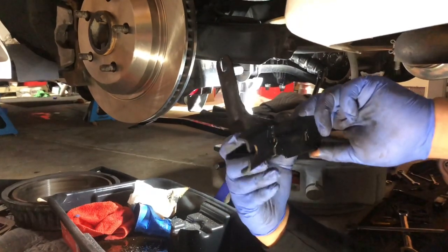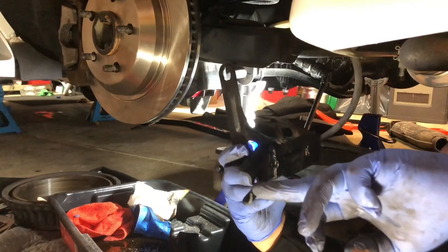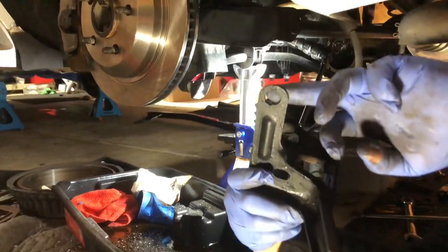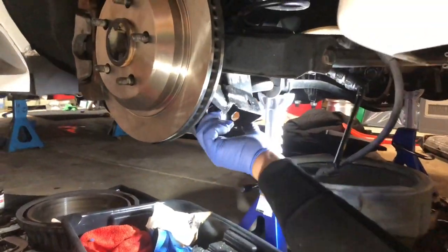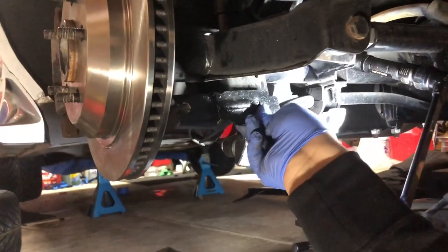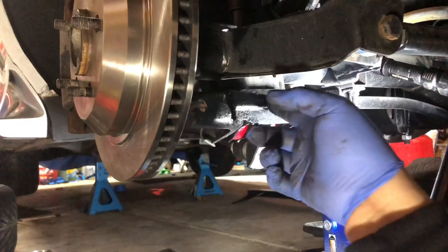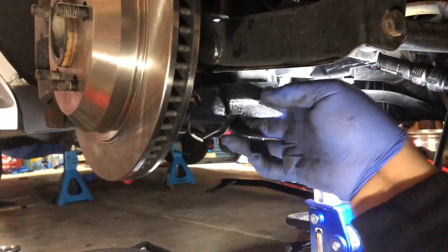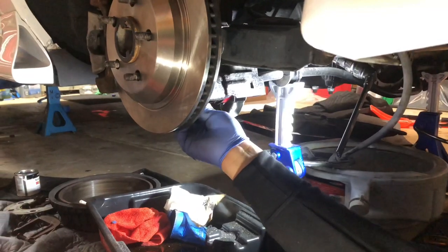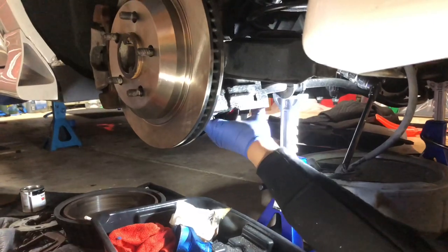This is the bracket that attaches to the lower control arm mount - it holds the parking brake cable here and your flexible hose for your brake line at this end. It goes right up in here just like this, but it has a tab here. So what will have to happen is you'll have to drill a hole so that you can get your bolt lined up and this tab has something to hold on to. I've got my hole drilled, I'm going to put my bolt back in through my lower control arm - and a perfect fit.